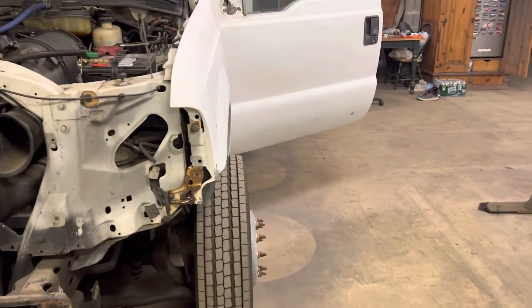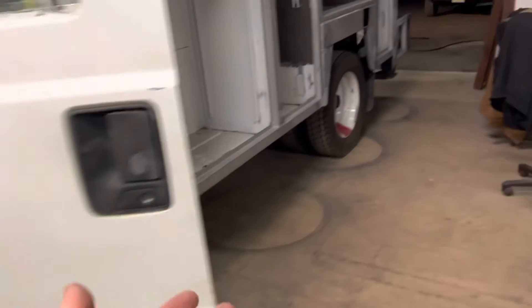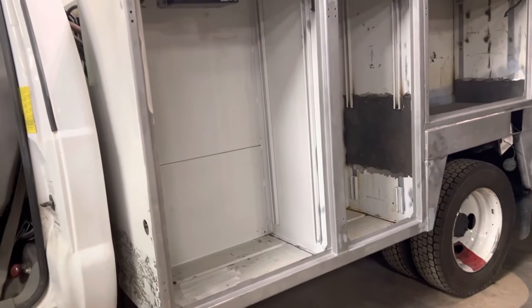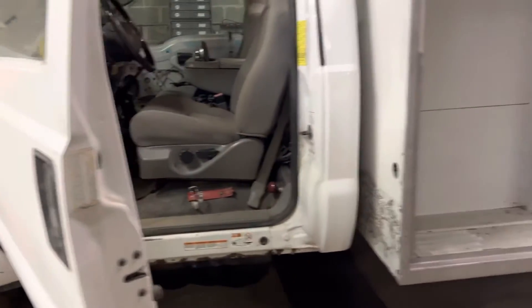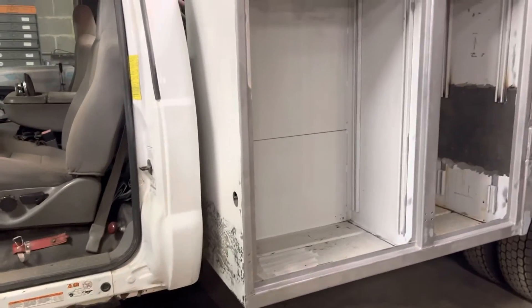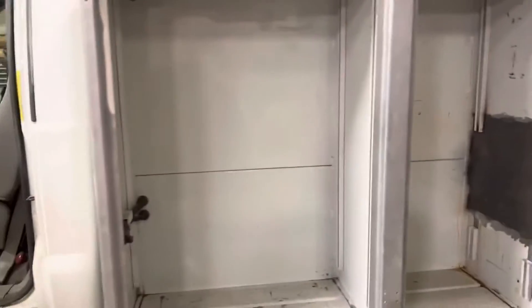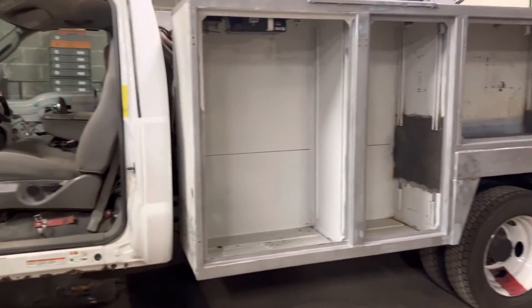All the body work is essentially done. I just have to do underneath the cab with the wire wheel, as well as the front of the body, and then this thing can get primed. The inside can get raptor lined, the top can get raptor lined, and all the bare metal can get primed — that way when it goes up to get paint it'll be protected and can just get another coat of primer before finally getting some color on it. It's been a long road; there have been a lot of issues and times I just didn't want to work on it.